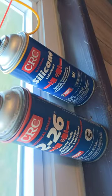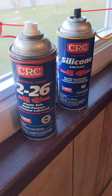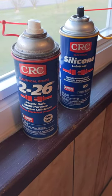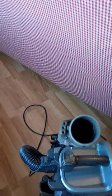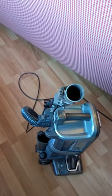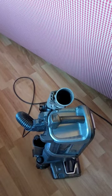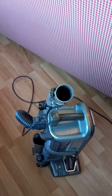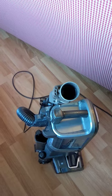Then use a product like one of these — electrical grade silicone sprays that are plastic safe. Hopefully these will lubricate the spring-loaded connectors and you shouldn't have a problem again. This will save a lot of aggravation if you do not have a broken belt or some other problem. There we go!